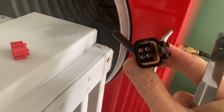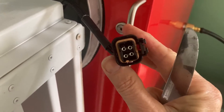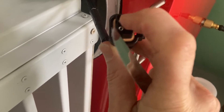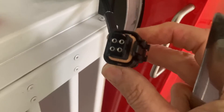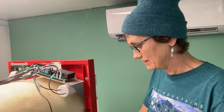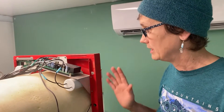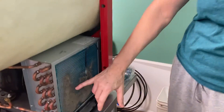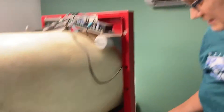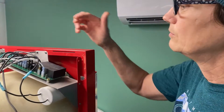I'm having mid-batch heater failures, so I'm going through the barrage of what to look for. You want to make sure that these are all level — sometimes the wires get pulled out a little bit. Those look fine, so it is not at the connector. We're going to finally get in here and try to take care of this mid-batch heater error problem. Upon taking it apart, I noticed this fun little thing here — we're going to clean that up. It seems to be some sort of temperature wire, so we're not sure if it's related or not, but we're going to clean it up and figure it out.